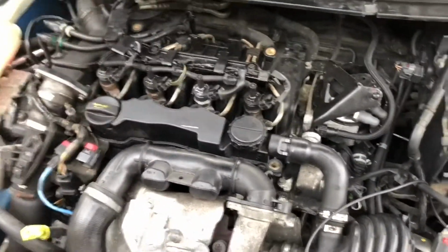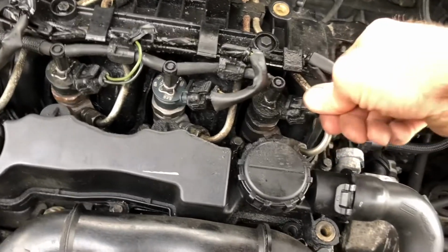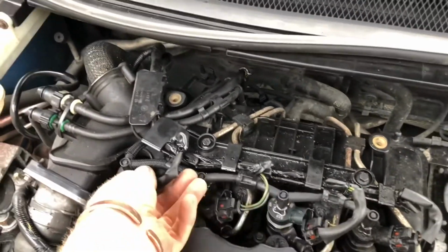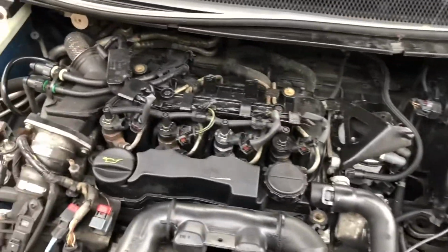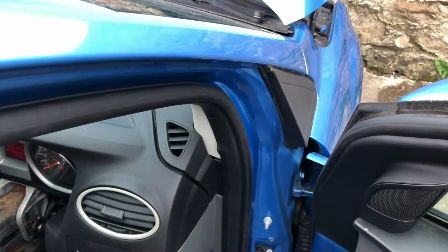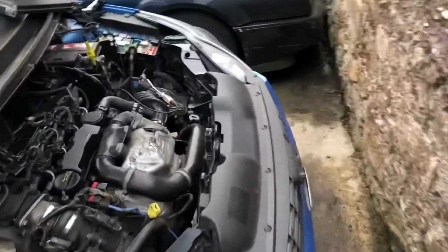Now, I'm going to show you this, and I'll tell you in a little while how we discovered this. This is not the fixing of it. This is only seeing something, noting something that seems to be having a strange knock-on effect. I haven't got a clue what's going on here, but if I disconnect the four injectors and go back around again, now when I crank it, whoop. The battery's getting flat, but she cranks away madly when the four injectors are disconnected.